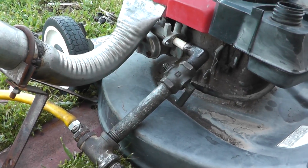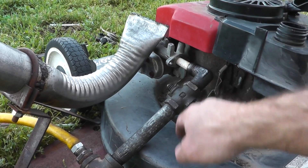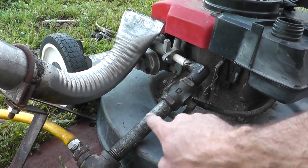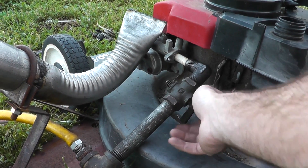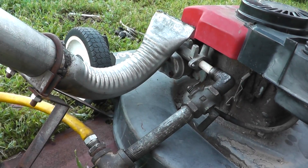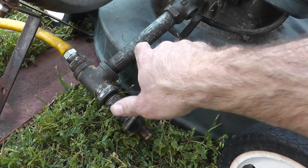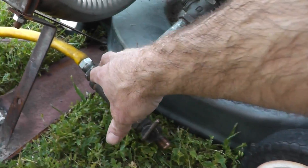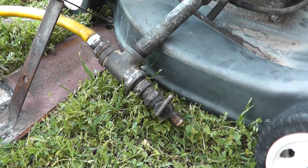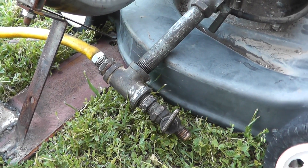On the other side of the engine, in place of that deteriorated carburetor, I've just plumbed in a valve. This is the main valve for the mixture of air and flammable gas — this is basically the throttle. Then I have the flammable gas coming through this tube. And right here I have an air inlet, which I'm going to have to adjust to try to create the right mixture. I can't just feed the flammable gas to the engine; it also needs a little bit of air to make the right mixture. So I'll have to fiddle around with that once I get it hot and hopefully we'll get some fireworks.